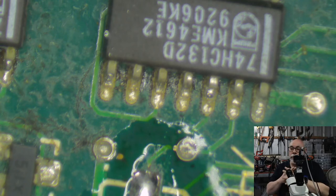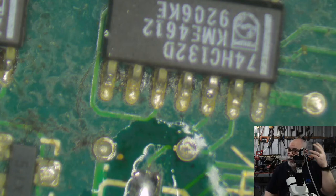So it's either something in the isopropyl alcohol, or what was on the board before hasn't been properly washed off. I can't say for certain what the residue is, but this cleaning process that I follow here, with the ultrasonic into the isopropyl alcohol and then into the oven, the boards come out spotless unless my ultrasonic cleaning fluid is dirty. And then sometimes I get little bits of gunk left behind. So I can't answer your question exactly, but I'm just offering some possibilities.